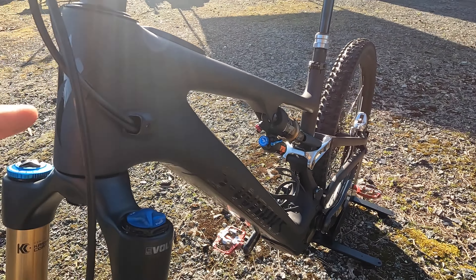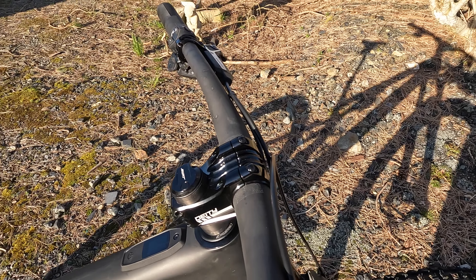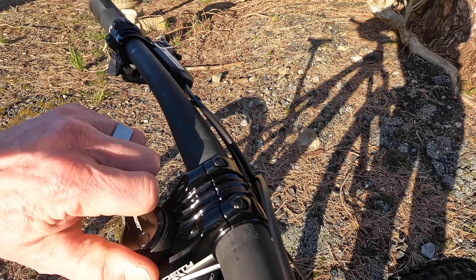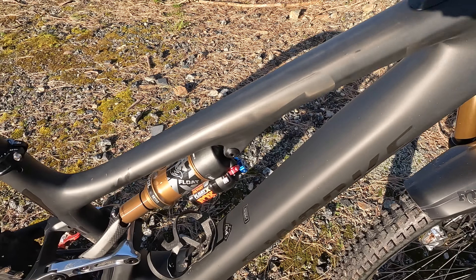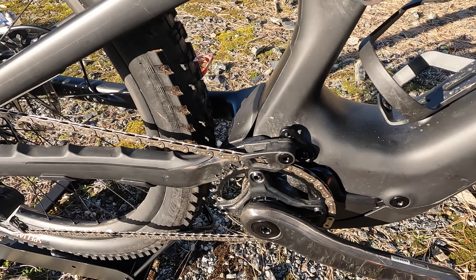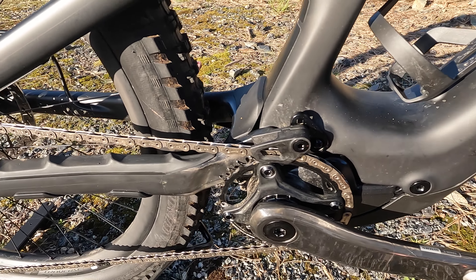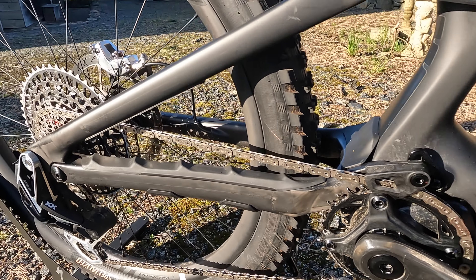The cables go into the side of the frame on the Specialised — it's not an internally routed headset because that would foul up the ability to easily change that headset angle. Other neat features: a Deity stem, carbon bar, and the little SWAT tool popping out with a mini tool inside. You've got a bottle cage mount that works with the range extender — a 160 watt-hour auxiliary battery — and there's a little rubber flap on the back of the frame to stop stones getting in between the lower linkage and the mainframe. There's also a really nice acoustic chain guide, top and bottom on the chainstay.